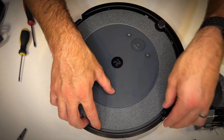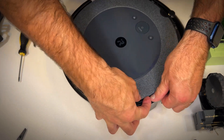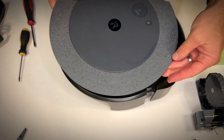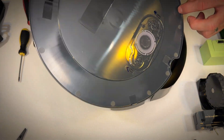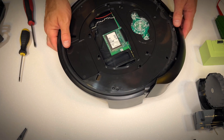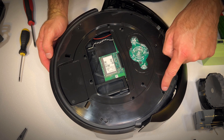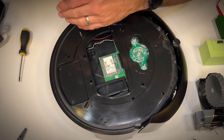Let's flip this thing over and try to get the cover panel off. It'll be held on by plastic lugs so I'm going to pull on it and pry it up. There are two lugs — if you push up on them from the bottom and pull at the same time it pops up very easily. Now that we're in here, we have a bunch of screws holding this assembly together — there's an outer circle of screws and an inner circle, which I'm pointing to now. I'm going to unscrew all of them and then attempt to pull the cover apart.